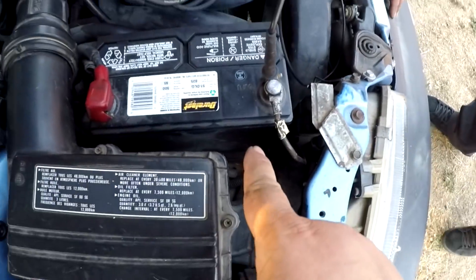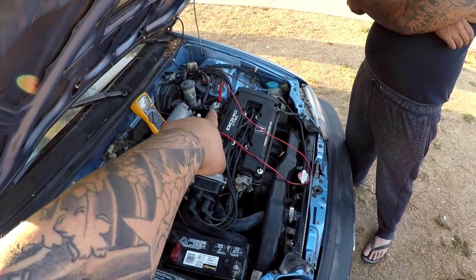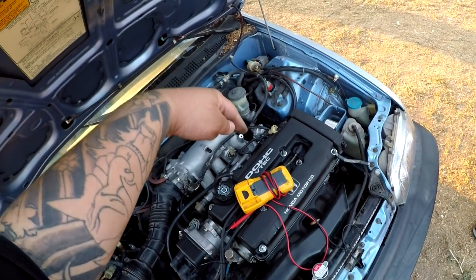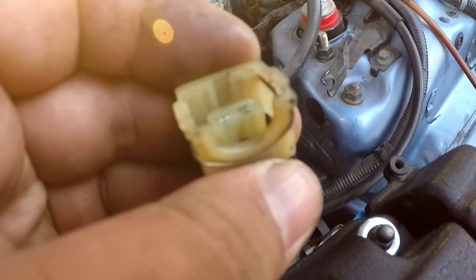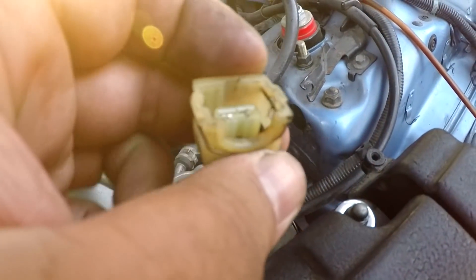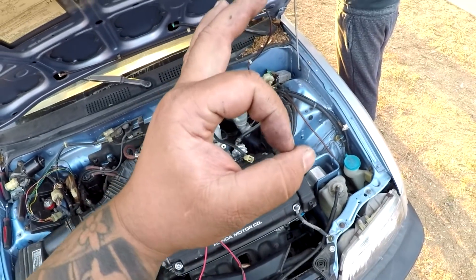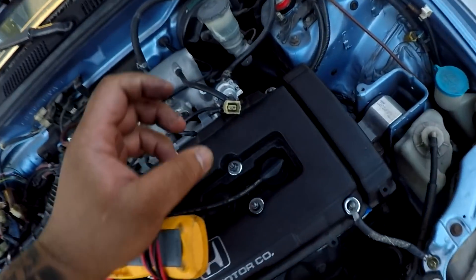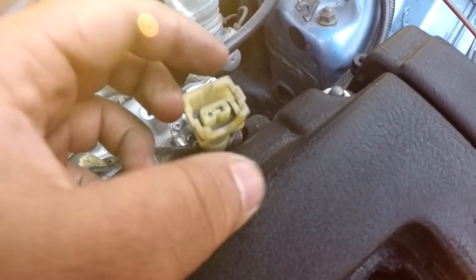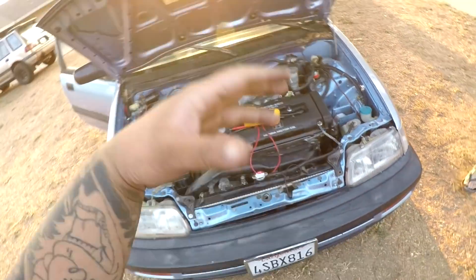This is a mystery right now - we've been tracing wires for quite some time and we're not sure what's going on with that injector. After further digging into why the injector was firing every time we put the pin in, I told my brother maybe every time you stuck it in there it's pushing the pin down. He took it off and this is what we find - half the pin is gone and it's not making the connection. It's called a spread pin. It's supposed to be closed to make a connection, but because it's so wide open the pin is bouncing around in the larger perimeter. We're going to take it out, find a replacement plug or just the pin itself, put it back in and hopefully square up the injector issue.